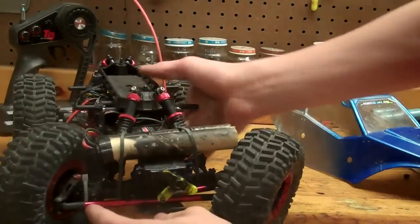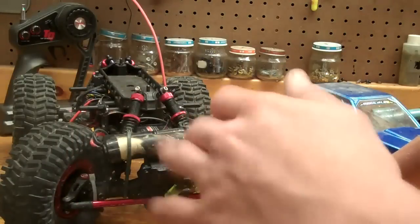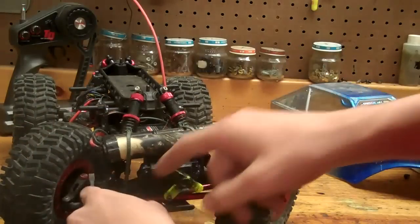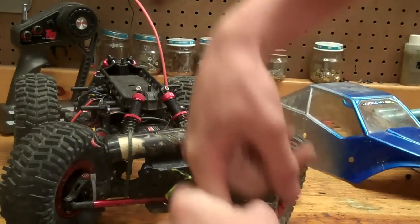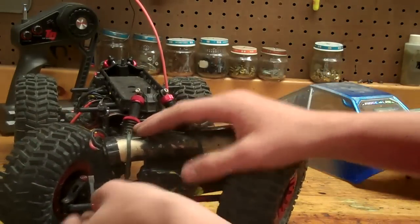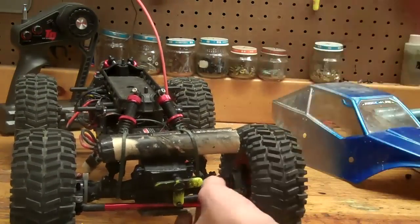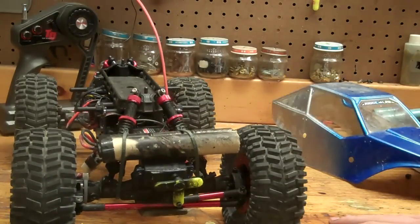Another negative is their design — the way their design is on the CVDs. It's the worst design I've seen ever. The way it works: there's a pin, it goes through a cup, and that pin goes through the top and through the joint that goes into the drop shaft. Where the pin goes through, it tends to slide around, get bent, and pop out. The pin will stick up at top, and when your car drives it'll get stuck on the C-hub and crack it. Both fronts are cracked right now — that's why I've got a zip tie on one. I cracked that one yesterday. They should really go back and totally redo that design.